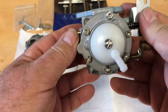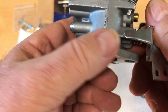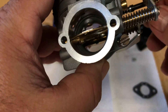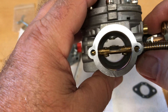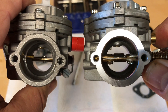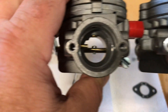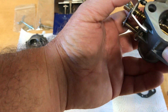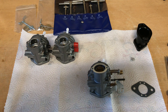This is another one I haven't showed you yet. I bought this — it was supposed to be a Harley Davidson golf cart replacement carburetor. It's not branded; I can't find a name or number anywhere on it. I paid right at 20 bucks, a little less, for this one. It's kind of weird — the throttle is spring-loaded to where it stays open. I've never owned a Harley Davidson golf cart, so I'm not sure how that works. The venturi on the Harley replacement carb looks bigger — about the same size as the one I used on the Ducar Tillotson build.